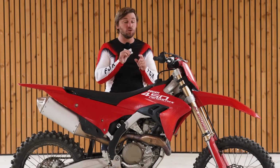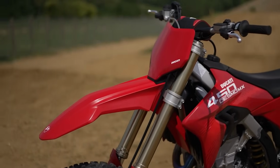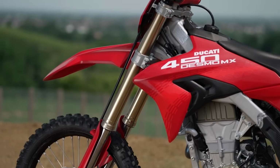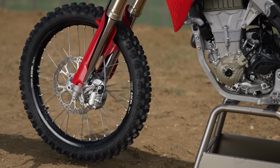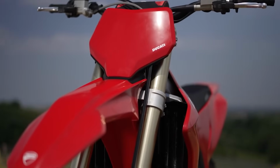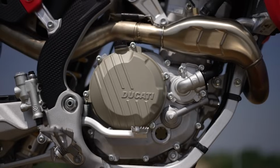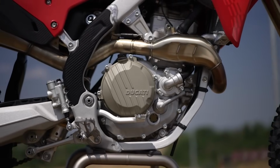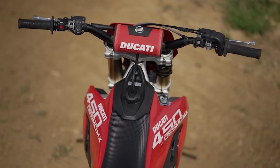And what I love is you can assign those to either map. That's something I've complained about with other OEMs that they don't do that well. So if you wanted to put both maps on aggressive throttle, the same traction control, but you just want to see the difference in engine braking, you can do that. You can assign them each to a different color and have all the parameters the same except for the engine braking. Or you can have the engine braking the same and just do the throttle response. Or you can do all those the same and only test the traction control. So very effective to run through everything on the fly because you can just bump that button so easy and figure out what combination you actually want.